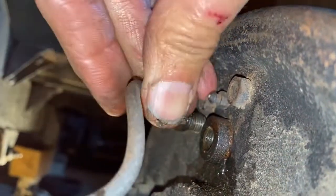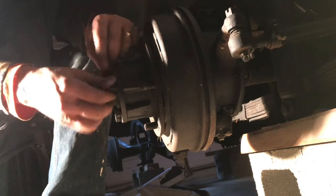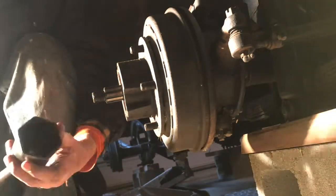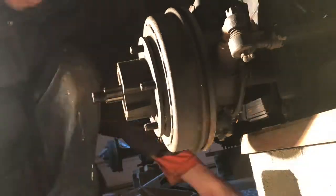There we go — set that off to the side. Now I'm removing the front wheel hub nuts — these are 9/16 size. It helps if you crack these ahead of time before you take the tire off. Now I'm taking out the bearing. I had packed this bearing about a year ago, so I'm just being very careful pulling that bearing out.